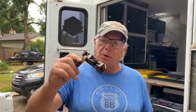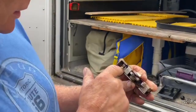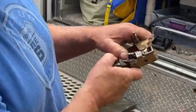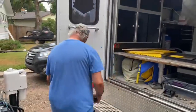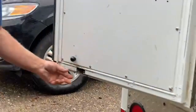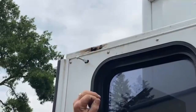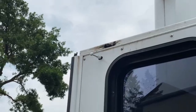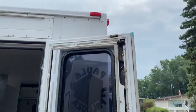Welcome back. We're getting into door locks now. Some ambos don't have these, but the trick with these door locks is they have a steel mechanism and a spring. This one seized up — it won't lock. See how this lock should work like this one? It should lock and then open like that. This one here works really good. What I did when I came down the other day was soak it with SeaFoam and just let it sit.